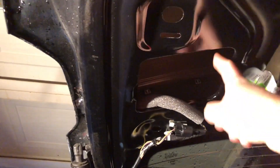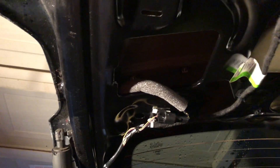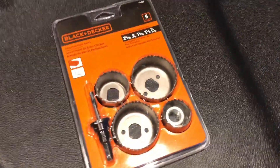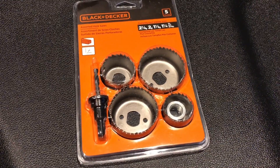What we're looking to do: there's a hole right here, this rectangle shape, and then there's another one of those equal on this side. We're basically just centering the panel so that we drill one single hole right there with the hole saw — that's where our rear flood puddle lights will go. There's a trusty hole saw kit here: two and an eighth, one and a half, one and a quarter. I believe we're using the two-inch bit but I'll confirm that in a minute.